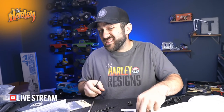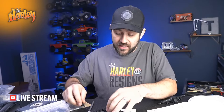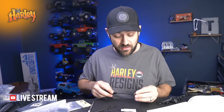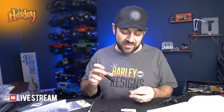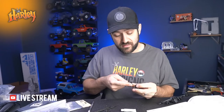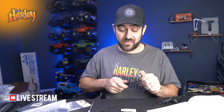Hey, Sammy Lee, also another donation. Thank you. Is the SCX10-II still relevant with the SCX10-III? Also, are AR60 Vanquish axles coming back anytime soon? First question: I think the SCX10-II is still relevant. It's a nice, simple base. I think it's a much easier platform to base a custom build off of compared to an SCX10-III, where there's a lot going on with the transmission and all of that. The SCX10-II is a straight axle version, and I like straight axles over portals in a lot of situations. There are also unlimited aftermarket parts, availability and options, things you can do. So I think the SCX10-II is super relevant still.